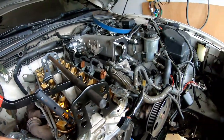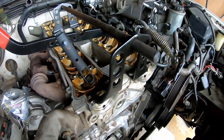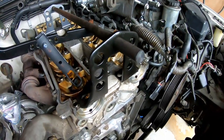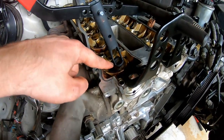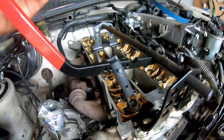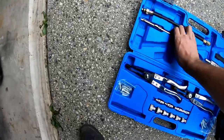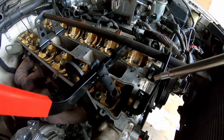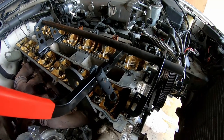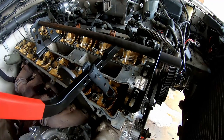Here's the short and curly of it. With our bracket, we bolt it into the holes that the camshaft caps go into, then we slide this lever bar in at the right point with a little pivot pin. This is the part that pushes down the spring. Once that's all in there, you pull down on that to lever off and compress the spring, then you can see there's a hole inside where we use the little magnetic tool to grab our collets off the top of the valve. Then we take our valve spring and cap out, leaving the valve stem seal exposed.